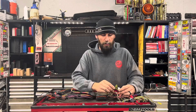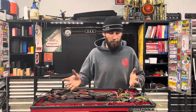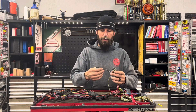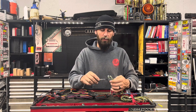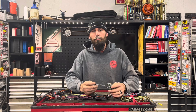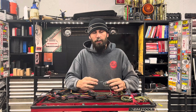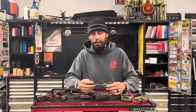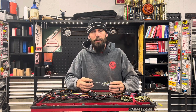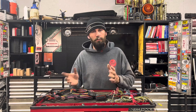And you're done — nothing else to fuss with there, that will get it in your car powered up. We didn't talk about your drive-by-wire pedal. If you have a drive-by-wire swap — most of them are except for the early 2.0 Mark 4 cars — your pedal must match your motor: if you have a gasoline motor you need a gasoline pedal, if you have a diesel car you need a diesel pedal. They won't interchange. It doesn't matter if they're automatic or manual — all the pedals work for automatic or manual for these swaps — but you must have a gasoline or diesel pedal that matches the motor you have.